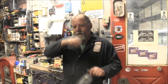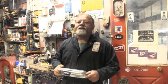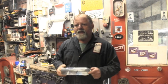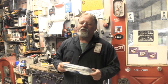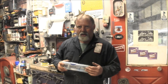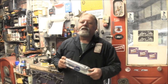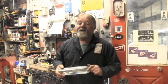Well, we got the little four-stroker Yamaha 9.9 going, but I think that recoil starter spring or something needs a little attention, and a few other things. But what I'm going to do is, based on the old Mercury hatch door system or the pull butterfly flap system, see if I can't come up with some kind of manual choke for this little guy.